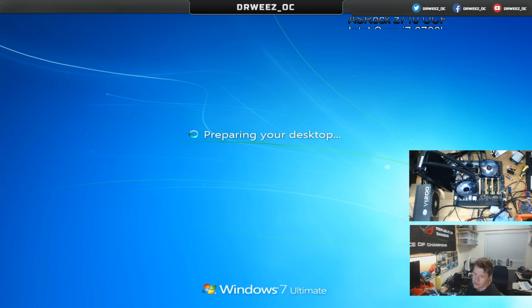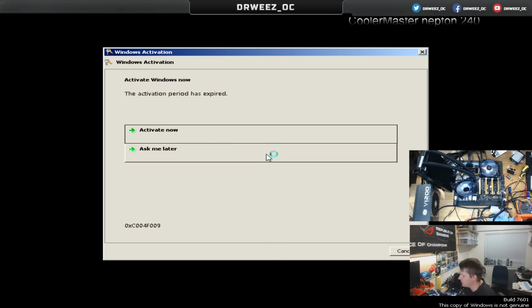You're quite correct, yeah. At that stage, it would have been advisable just to drop down the frequency just to get a score. But the blue screen was definitely around memory management, and I was actually just trying too hard to get that 3466 with those very stupid tight timings. What I should have done straight from the beginning is actually run with looser timings and then tighten up as I progressed. I did it sort of backwards, but it was just to get the gist of it.